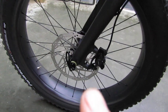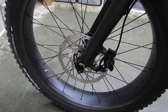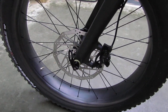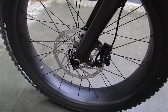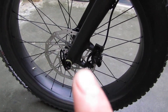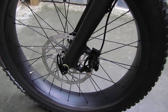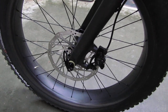On the big red Mongoose bike I found that these 203 millimeter rotors made a huge difference in stopping power. I had these rotors left over from a Yeti ASX bike from around 2003 and already owned them, so all I had to do was buy 203 millimeter adapters. Huge stopping power with the 203s — if you've got 160s or 180s on a really heavy e-bike, go to 203s, you won't regret it.